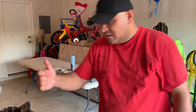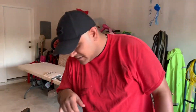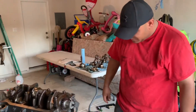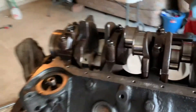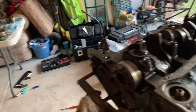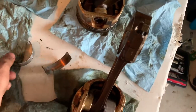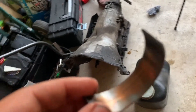We're almost ready to take it out to the machine shop — get it checked for cracks, get it dipped and cleaned out, take the crankshaft to get polished, and the cam to get polished up. Hopefully it's still good. And hopefully the cylinders just need a nice cleaning or bore out and we'll start putting it back together. Everything kind of looks okay other than the rod bearings — all of those look pretty bad, they were all pretty shot. The bearing looks like it's kind of spinning out or something. They all look pretty damaged.